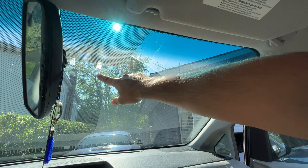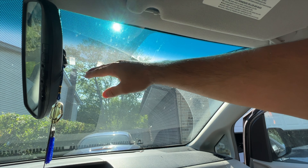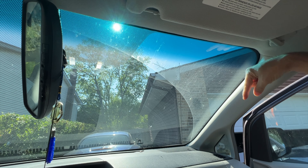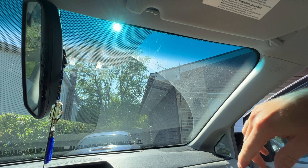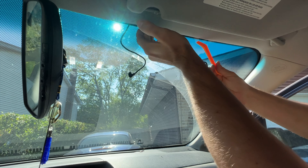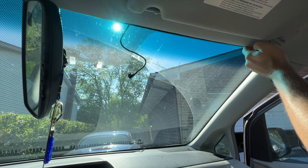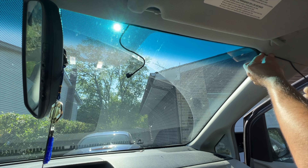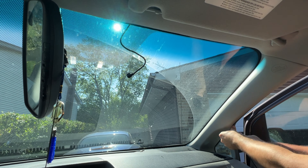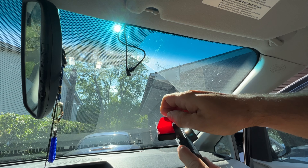I plan to mount the camera behind the rear view mirror so it's not in the way of anything. I'm going to route the wires behind the headliner — one wire going all the way to the back for the rear camera, and one going down to the power plug in the center console. I'm using simple tools — just a trim removal tool, which is about 50 cents on eBay. There's plenty of space behind the headliner on this 2015 Toyota Sienna. Now that I have my wires in place, I can mount the camera.